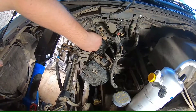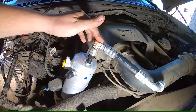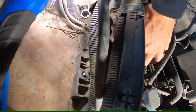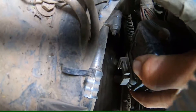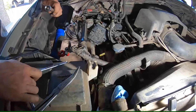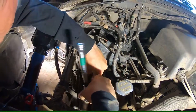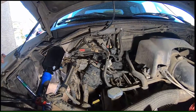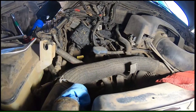Now with our new accumulator, we're going to put this back on and reinstall it, so you want to save that. Zoom in on the accumulator — that bolt right there is going to come out and disconnect your line. That's 13 millimeters, a little pain to get to, but that's a hazard of working on your vehicle. Everything is a pain to get to. Now I'm going to reach down — you have a bracket holding the accumulator. That's another 8 millimeter bolt.